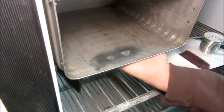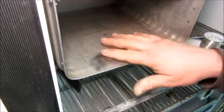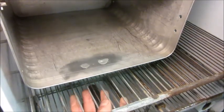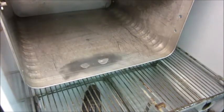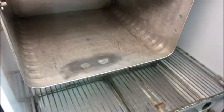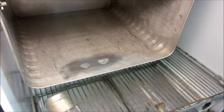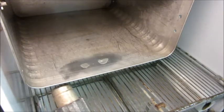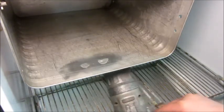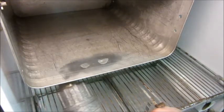The vacuum pump is running. It sounds like there's some boiling going on — that's probably because there was moisture inside there. I'm going to put some heat on this while the vacuum pump's running, and I'm going to try to get this top shelf out to get a little more room to work. I'll use the heat gun to heat the bottom and warm the oil that's inside it. I want to get the whole evaporator where it's too hot to touch. I want to do all this before I change the dryer, because I don't want the new dryer to saturate immediately if there was water and moisture in here.